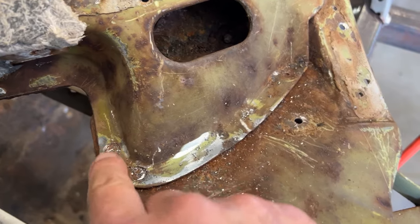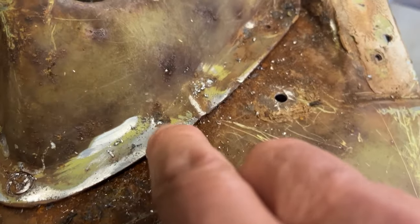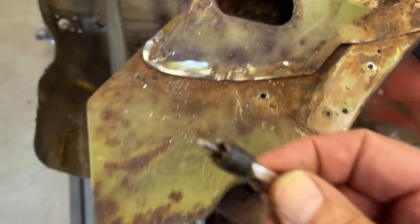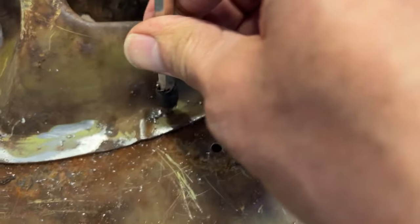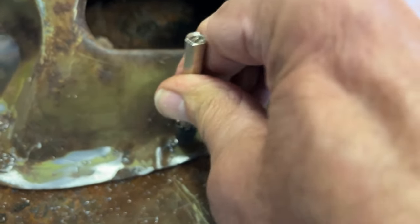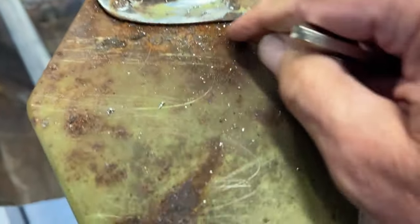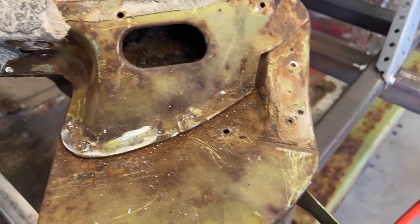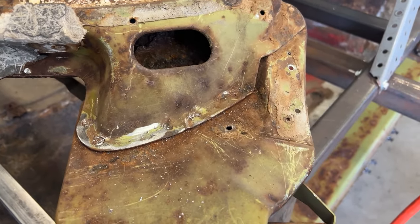What I'm doing here is I've drilled a very small pilot hole, and I'm using a spot weld bit like this. You stick it in the pilot hole, the spring load comes down, and as you can see I already have this one drilled out - it drills out the spot weld. These bits are expensive, so if you're not careful you can break them. They're working good for me so far - you've got to take your time and not get too impatient.